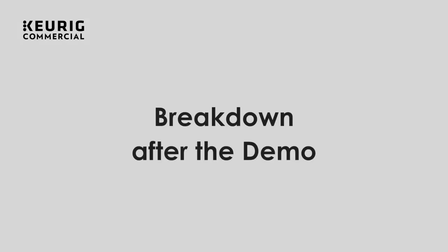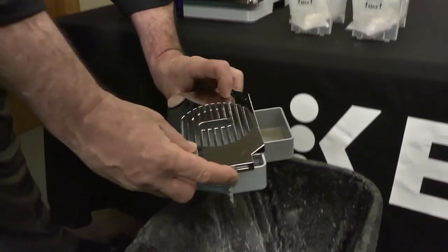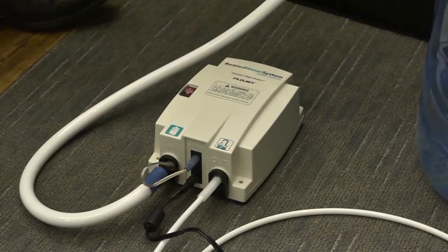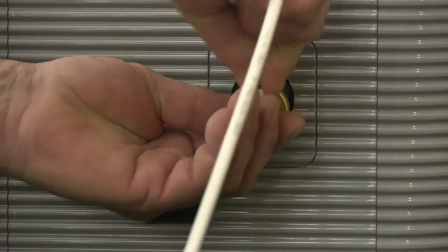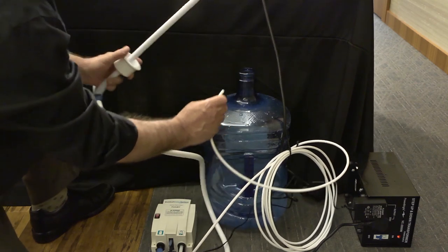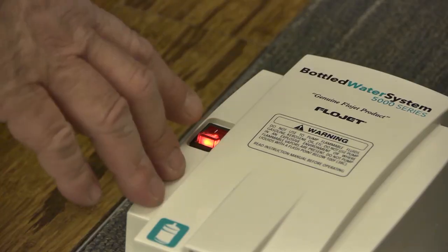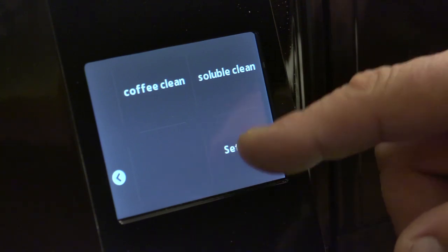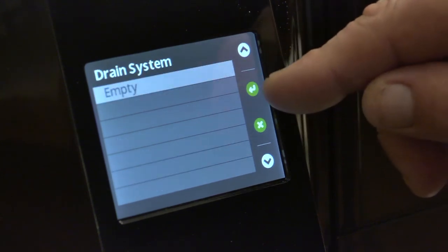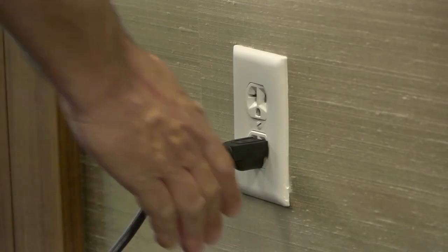Break down after the demo — it's very important to follow these steps. Remove and empty the powdered hoppers. Empty the K-cup pod bin, then turn off the Flowjet. Disconnect the Flowjet line from the brewer by pushing on the gray collar and pulling the line out. Take out the large white probe from the five gallon water jug. Put the end of the Flowjet tubing into the water and run it so that all the water drains out of the Flowjet tubing. Then turn off the Flowjet. For the brewer, run the hydraulic circuitry to empty the brewer. Turn off the brewer and disconnect it from its power.